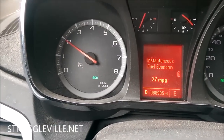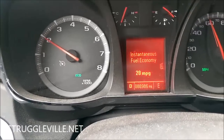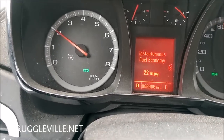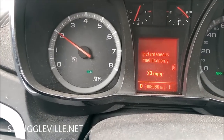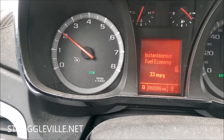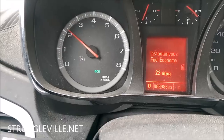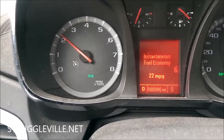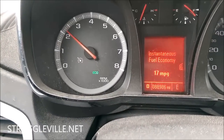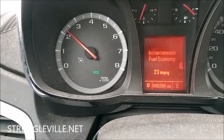I've gone about eight to ten minutes and as you can see there's no check engine light back on — seems to be running pretty good. All the links will be in the description below. One thing to note: the only visible difference between the two sensors is the exhaust has black plastic on top and the intake has gray plastic on top. That seems to be the way to tell which is which when you're buying new ones.